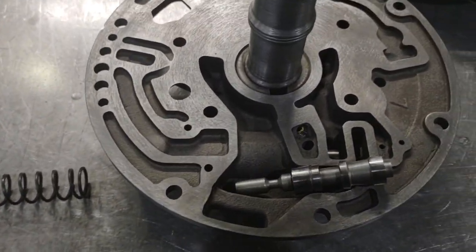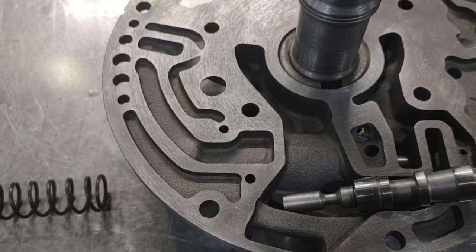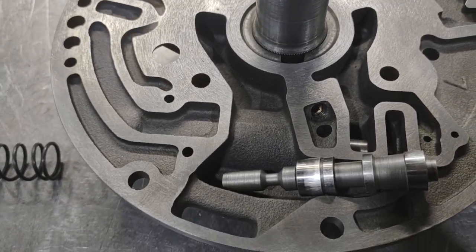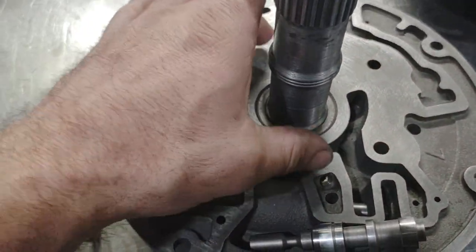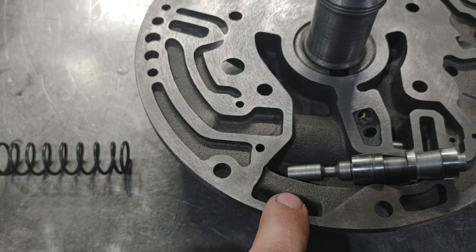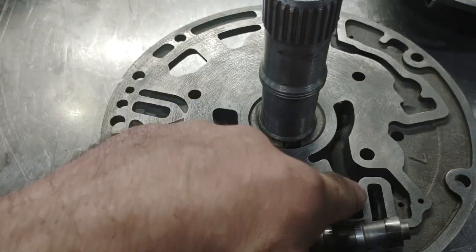I'm going to do a quick class on a pressure regulator. The pump in a hydraulic system obviously usually pulls fluid from the sump through some type of filter and it goes to the pump. The pump has a gear that spins in this area on this pump. This is the suction side — this goes to the case and down with the filter on the Turbo 400. The gear goes around the crescent, brings it around this side, compresses the fluid and puts it into these circuits.